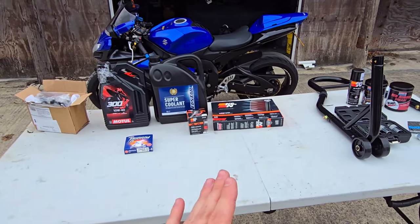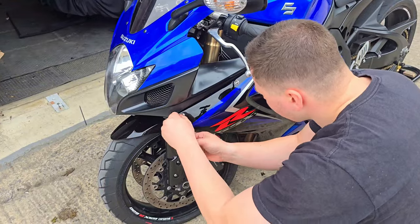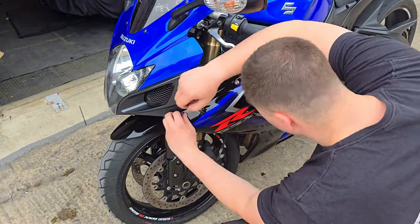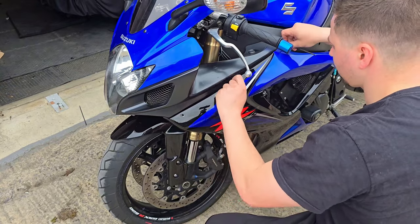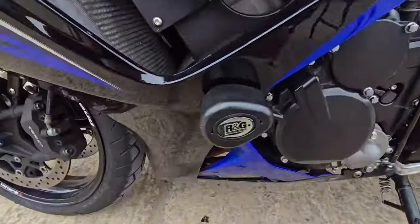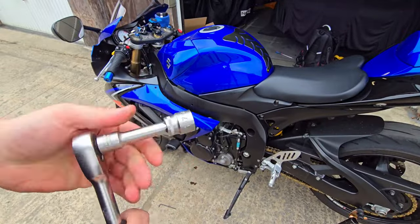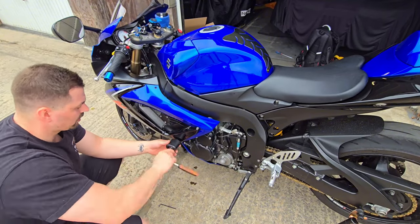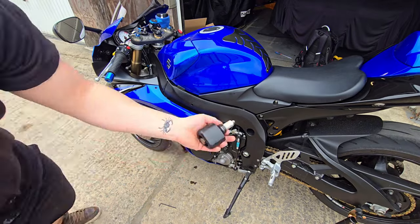Now I've shown you what I've got, let's move on to job number one — preparing the bike. Now that the bike is secured on the rear paddock stand, the next thing I need to do is remove the side panel. To do this there are several allen-headed bolts and clips to remove. The top three you need to remove first. There are also crash protectors fitted — you need to remove the cover on the front face, and there's a hidden 18mm bolt inside, then the whole thing comes away.